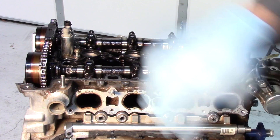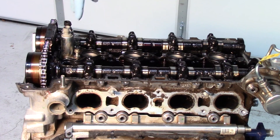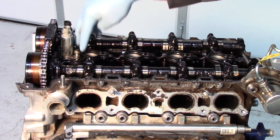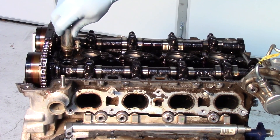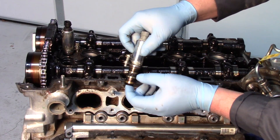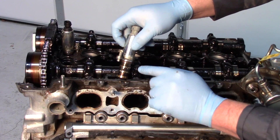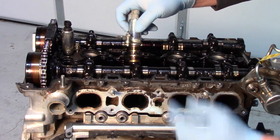The control of cam advance or retard is done through these two different solenoids. With the valve cover on, there's a little opening and the technician can unbolt two bolts and remove the solenoids. After a little prying and pulling to get them out, if you look at the screens they don't look too bad, except you'll notice some sludge — not a big surprise considering the state of health on this engine. That's a bad sign.